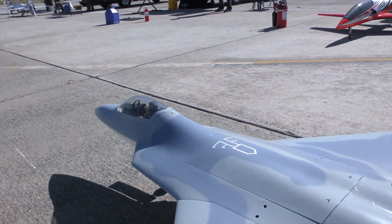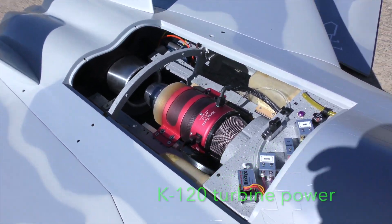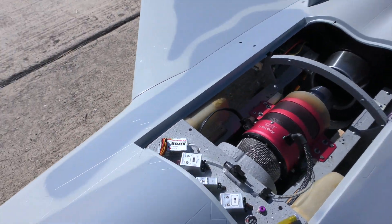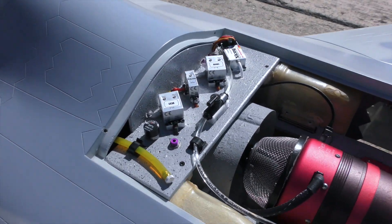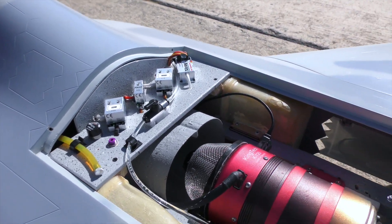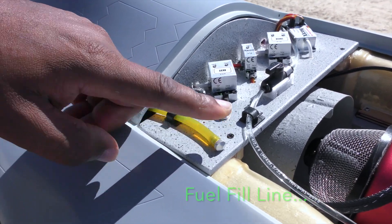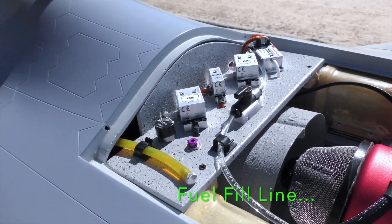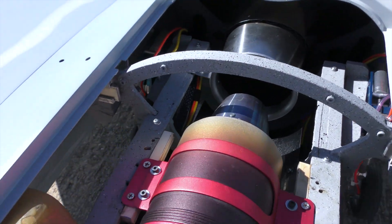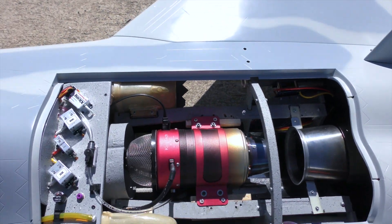In terms of the internals, this is what the internals look like. I re-worked a lot of this. You can see I have all of my pressure valves here that operate the brakes and the gear and the gear doors, readily reachable. I also have my fill valve. I cleaned that up pretty well and it's pretty clean in here. I am impressed and happy with how that all came out.